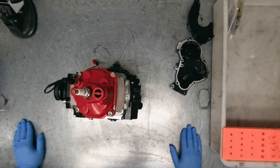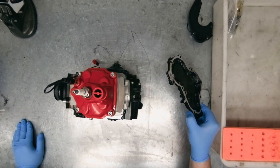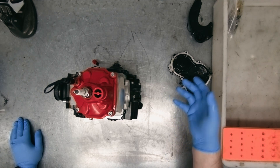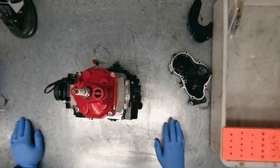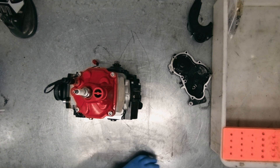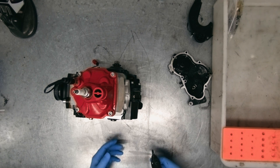Today we've got a JMAX that's had some gearbox trauma — the circlip disintegrated. It's been a long time since I've seen that. Every time a Rotax comes in, even if it's just a quick check-over before a big meeting, I change the circlips. I just don't trust them, and this is why. This motor — I did change the circlips last time it was here.